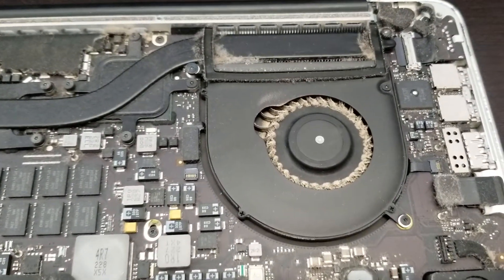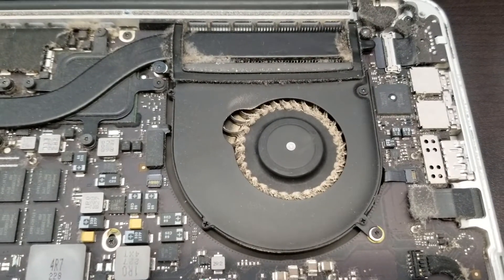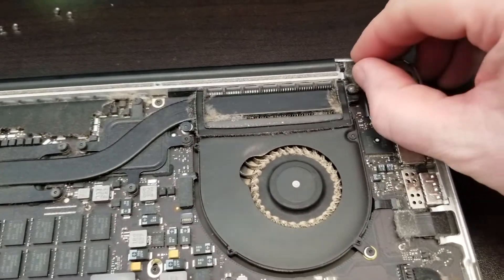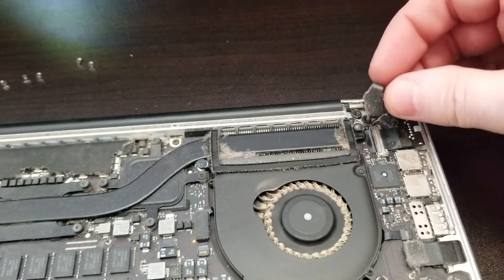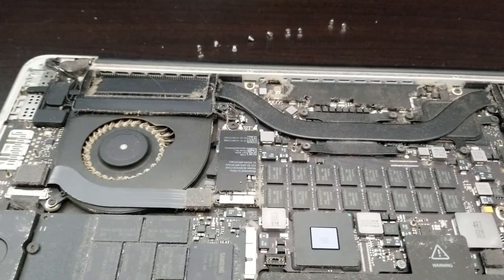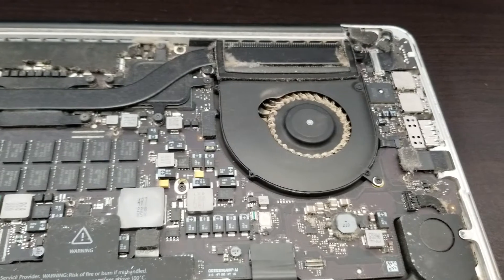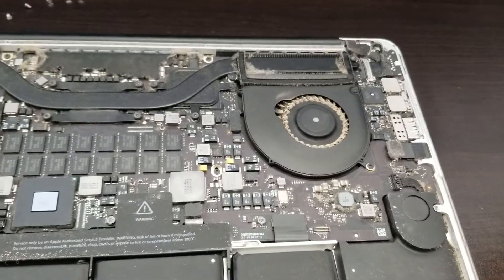You do not just use the air cans. You need to take it apart, use a vacuum cleaner or compressed air. Do watch out for these little components — if you put a vacuum cleaner to it, they tend to come off because they're just not held by anything. Make sure to take those off if you're going to be vacuuming inside. Be careful that you can nick some of these parts off if you stick a vacuum cleaner in here. If you do not feel confident and comfortable doing this, have someone who knows what he's doing clean it up for you.